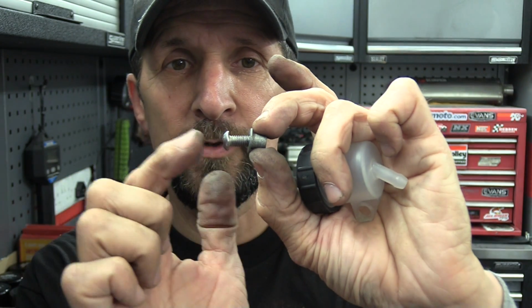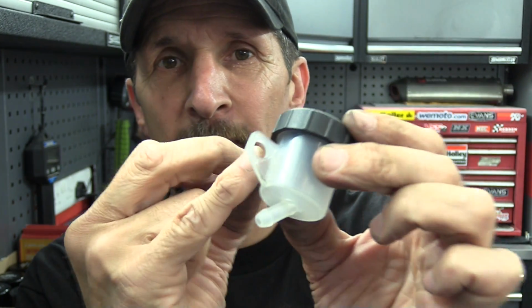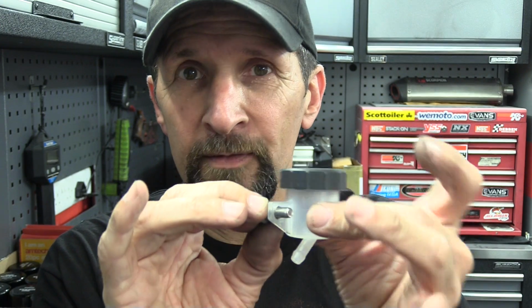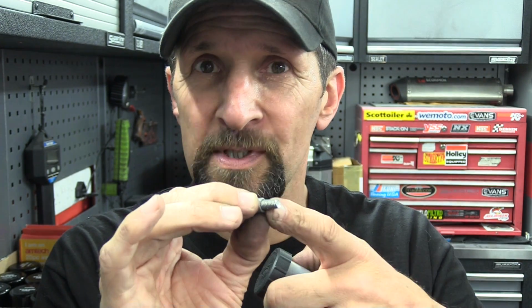I've got to modify it, got to cut it down a bit, but the screw goes through it, and that shroud will then sit inside this plastic hole, which is unprotected, and it means I can tighten right down on it so it's nice and secure and doesn't vibrate loose, and I won't pinch or crack that in the meantime, and that will be allowed to move around and just sit there gently and absorb vibration, but the bolt itself will still be nice and tight.